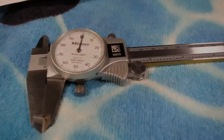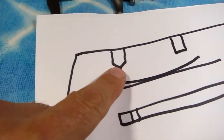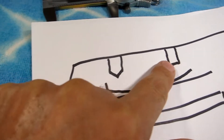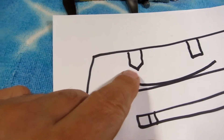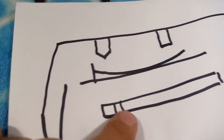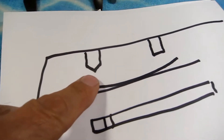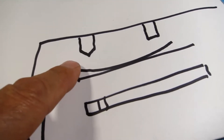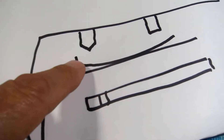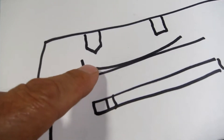This is definitely that set. I just want to show again so there's no confusion on this pointed set screw. You can take them both out. But when you put it back in, you see the hole of the shim? There's a side view of this bowed shim. That bow is supposed to be there — don't flatten it out. Don't bend it back and go, 'I fixed it, I made it flat,' because then you won't have correct adjustment.